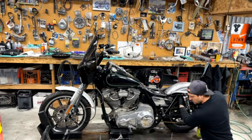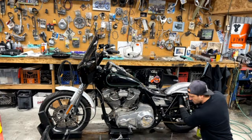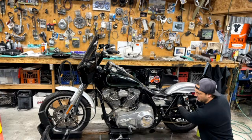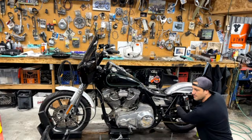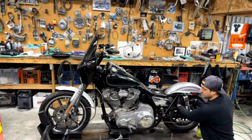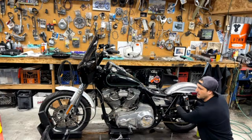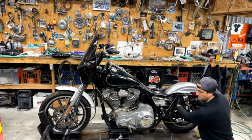If you use a silver base coat, does it have to be metallic or can it just be silver before you shoot the flakes? Usually silver does have a metallic in it — it might be a really fine metallic. If not, it would be considered gray — just black and white mixed. You can spray a flake right over silver, that's fine. I prefer to spray the Limelight over a black base coat because I feel like it has more sparkle. But if you're spraying big flake like 0.025 flake, you're best probably starting with a silver base because the flakes are so big it's going to be hard to get full coverage, and then you're going to get a speckled, salt-and-pepper kind of look.